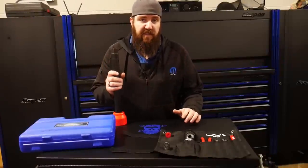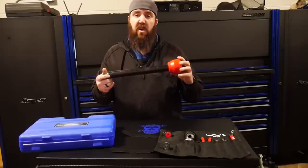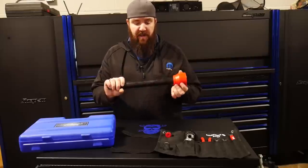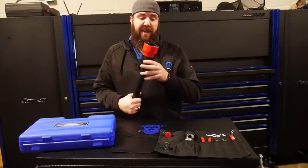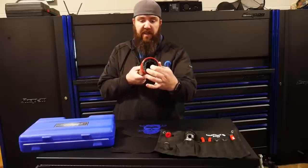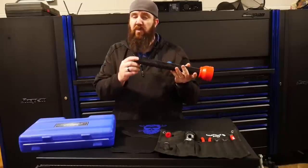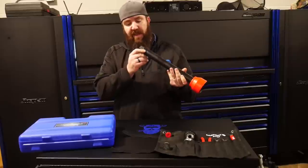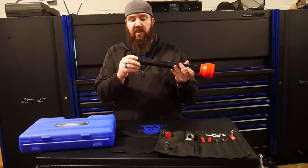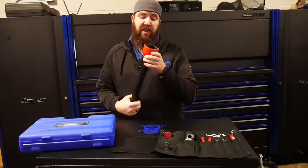Next on the nifty tools list is going to be this inner tie rod tool by Mayhew. Part number on this one is 29910. There are a couple of different manufacturers who make this one, but Mayhew I found is the one who has most of their stuff stamped on it and you can find just about the best deal and price on it. It does have a rolling clutch here in the end of it, a hollow tube to where you can put your inner tie rod into for a long distance — great for those trucks that have those extra long tie rod ends. And then here on the end, it is a nice one-inch end to it, so you can get a socket or a wrench onto it.